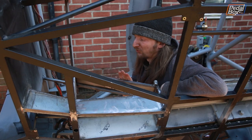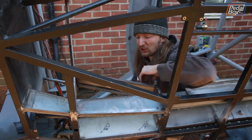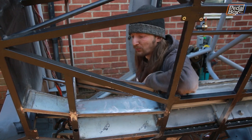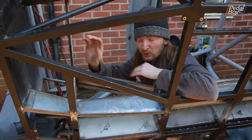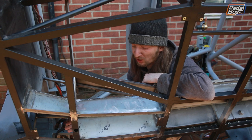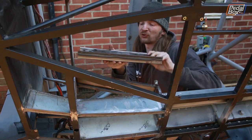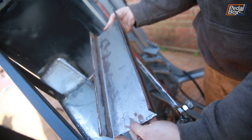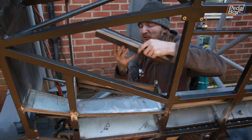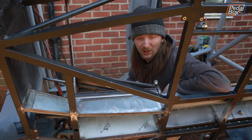After a couple of hours we've plated in a lot of the tunnel, leaving a couple of bits deliberately wide open — this big gap is going to be our first piece of storage. Everything else has been plated over with nice simple small pieces that we've just tweaked and welded in place. We're going to have to flip the car over in a minute and put a few more pieces on the driver's side. But before that we're putting in our first piece of storage: this little bucket tray that Adrian's been making up while I've been welding. We've reinforced the edges so it should stay in nice and strong — it just drops in here and we're going to weld that up now.